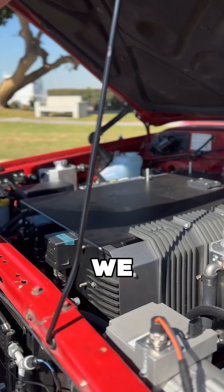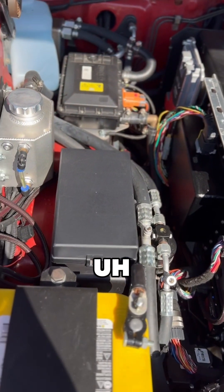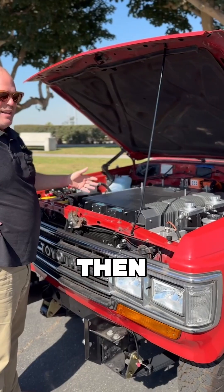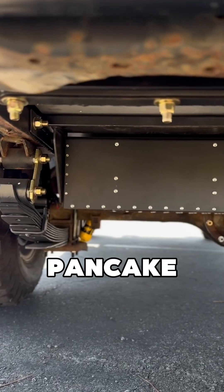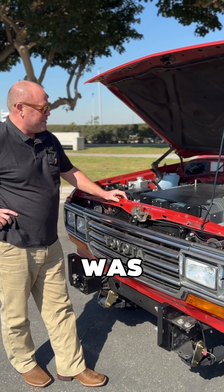Let's take a look at it — it'd be kind of cool. We put about 80 kilowatt hours in this truck. It fits super nicely. There's a main battery module in the front, and then in the back we have a pan battery that fits kind of like the pancake fuel tank that was in the car, and then a couple of side modules in there as well.